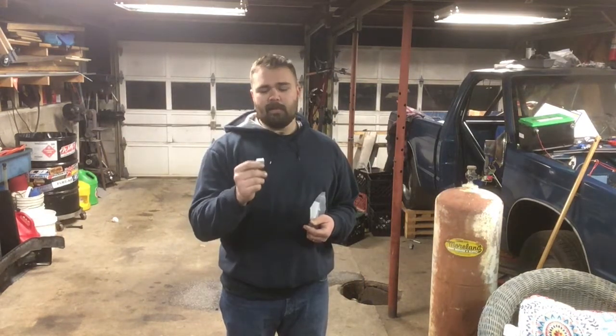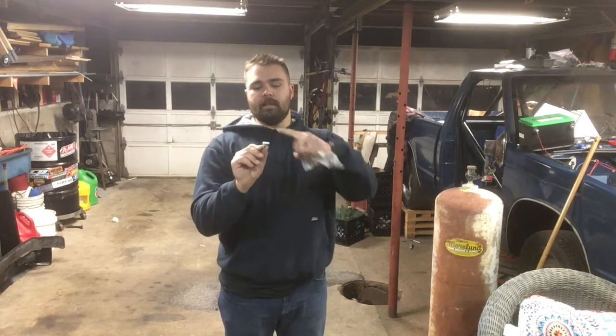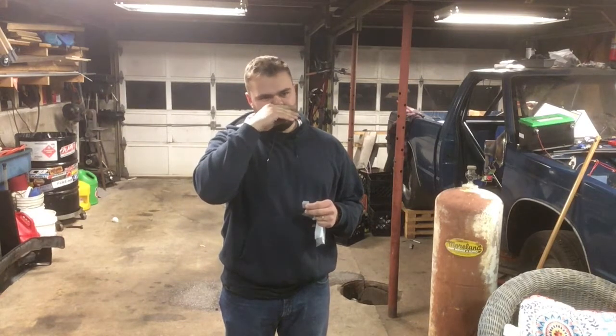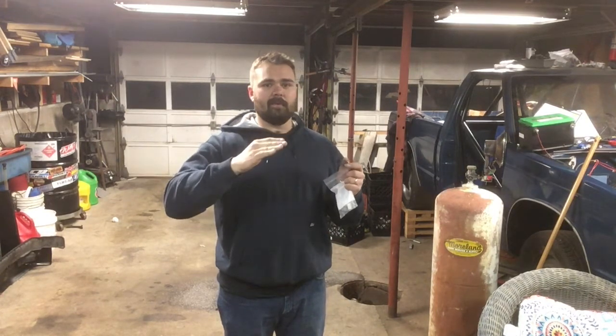But these are going to pop rivet to the car itself, and then we will try to attach the deck lid onto the top of here. I'm doing this just because I don't want it to be goofy when it's going down the track, and I don't want the areas that the wing is not supported. I want air to go across the trunk lid and straight up the wing. I don't want the wing bowing up where it's not supported and it's shooting down underneath.